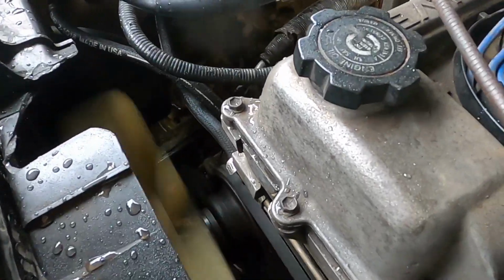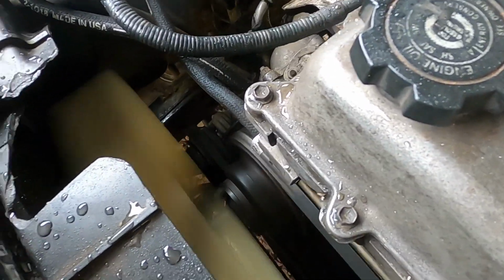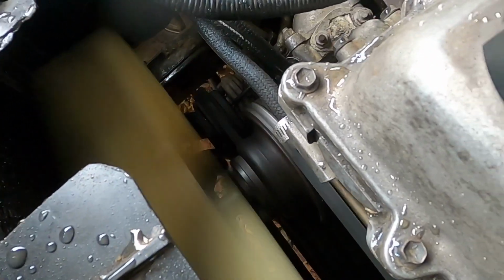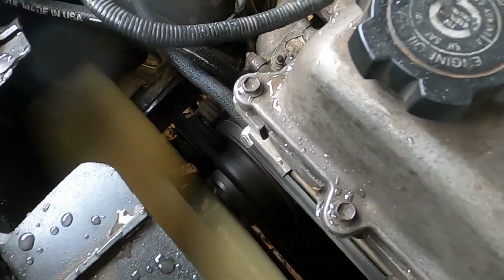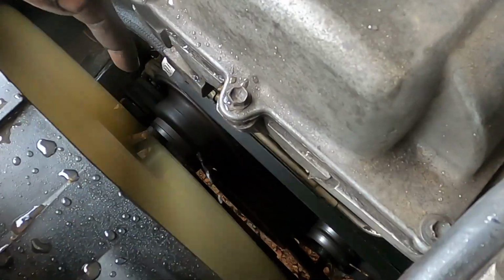This fan is not running directly on the shaft where it should be aligned, it's just running on the bolt holes. I think the fan is a bit off center, so there is slight vibration. As I can see, there's a little bit of wobble in the fan. But this is the 1JZ fan.